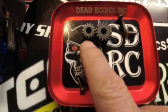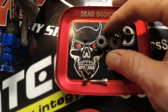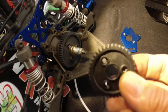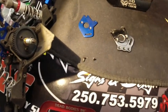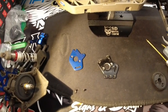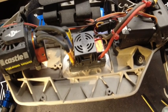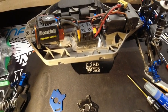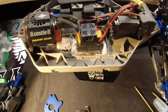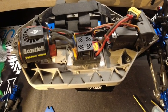So mod 1 here, 32-pitch here — just a slight difference in size, losing a bit of weight on the pinions. But on the spur gear I'm definitely adding weight with this big new metal gear over the plastic one. I don't think I'll be changing much of the overall weight, maybe slightly heavier. Hopefully the lower gear ratio works out and I'm not overheating — otherwise it's going to be time to step up to a new ESC, which I'll probably go with a Hobbywing Max 10 or Max 8 for a four-wheel drive short course truck. Let me know in the comments what you guys would do with your slash four-wheel drive.